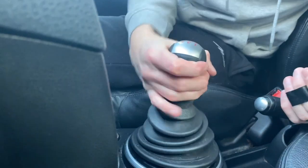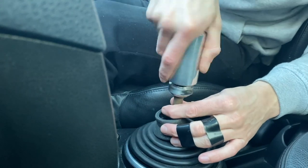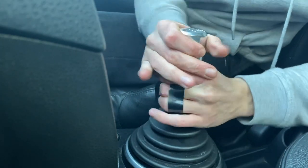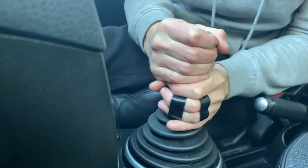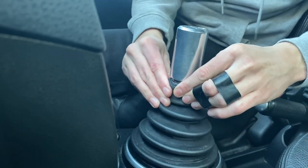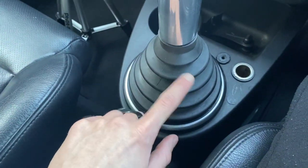The next thing is for the interior - an aluminium Mtech gear knob I bought off a subscriber, Roger Andrew, so thank you very much Roger. It's literally just a case of removing the rubber boot, unscrewing the old one, and the new one threads in. You do have to push it down when threading it on because there's a little rubber bung that creates resistance so it screws on nice and tight. I also noticed my rubber boot is split, so I'll be replacing that at some point.